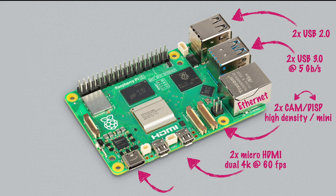Further down the line we have a USB-C port for power supply, same as the previous model, but now supporting just below 27W. The Raspberry Pi will consume up to 27W, which is frankly a lot of power. The previous model, the Raspberry Pi 4, had a default power supply supporting up to 3A, which equals 15W. So we are more or less doubling the peak power demand.